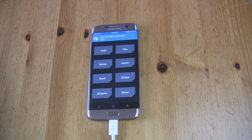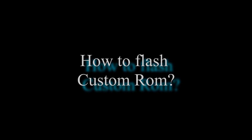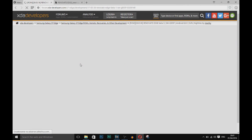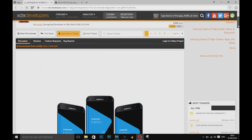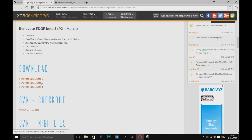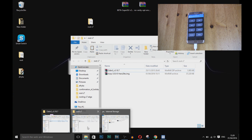Or you can go further by flashing a custom ROM. If you want to carry on, just follow these steps. First, visit the XDA Developers website for a custom ROM designed for your phone — all links are in the description. I have an S7 Edge so I'll go into the S7 Edge thread. You can read the description about the ROM, and when you're happy with it, find the download section and download the custom ROM to your PC. Then copy the zip file with your custom ROM to your device.